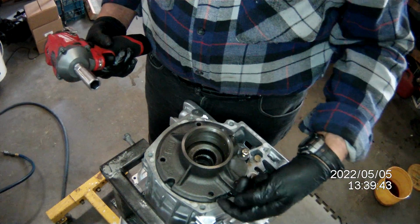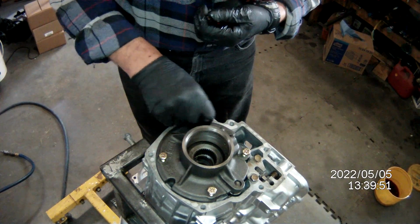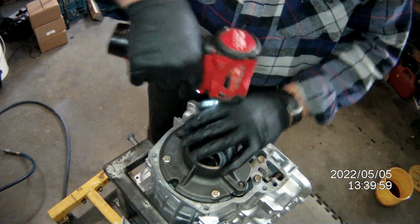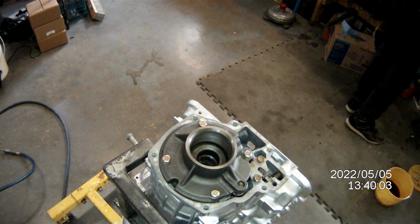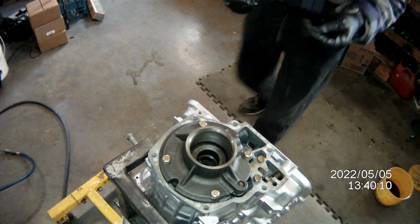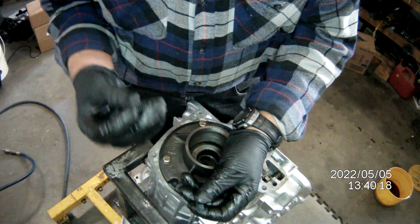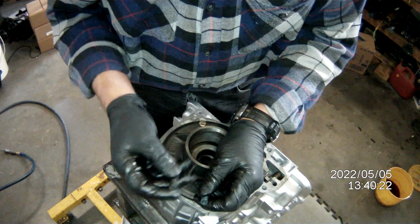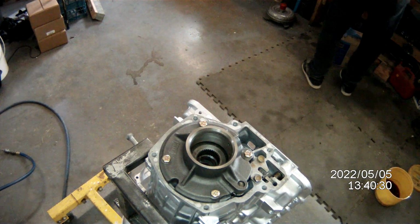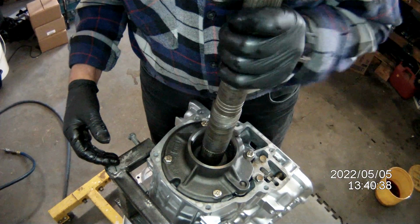Back up a little bit. This is turned down low setting, so it's only doing 25 foot-pounds. Another thing I forgot to mention, do not mix up your low reverse piston with your high reverse springs. See the difference? If you put one of these in the low reverse, first time they apply, that'll push a hole back out of that pocket. Okay. See, this is going to be a Transbrake C6, no governor needed.